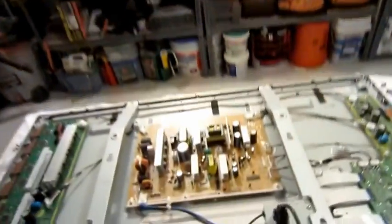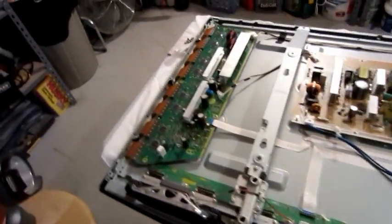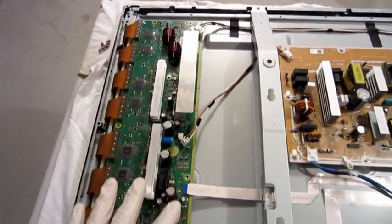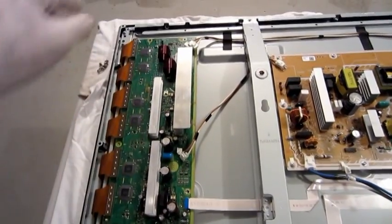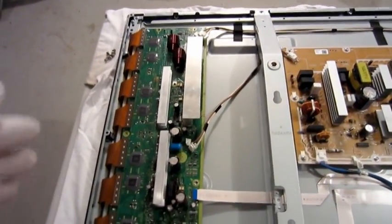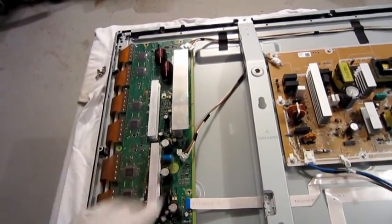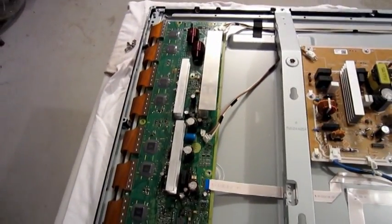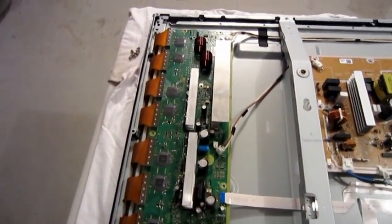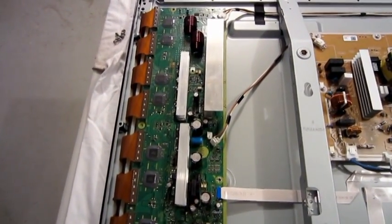According to the guide, if I separated the SC board and got six blinking lights, then I knew the SC board was bad. Since I have one board for the SC, SU, and SD, I know this whole board is bad. I got the six blinking lights so I'm assuming this is my culprit. When I get a replacement and put it back in, I'll hopefully show you that I was right — and hopefully this will help somebody else.